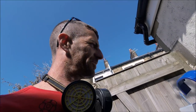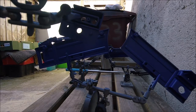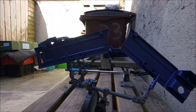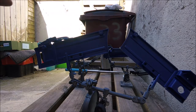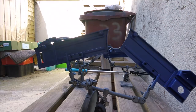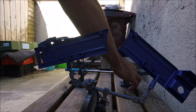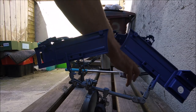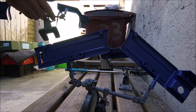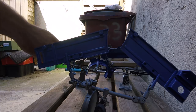Just before I start — as you've noticed on my first coat, I spray the backs of everything as well as the fronts. A lot of people just spray the fronts, so you end up with white backs. When you're looking into your chassis you can see the back of the skirts aren't painted, things behind the bumpers. I literally paint the whole part, but where I do the back it just gets the one coat, and then more coats go on the fronts where you're visually looking at the paint job.